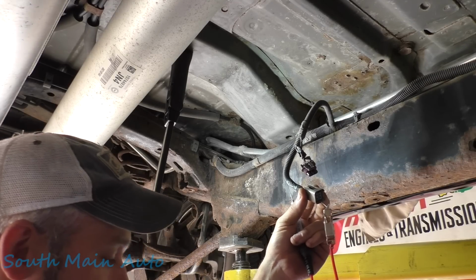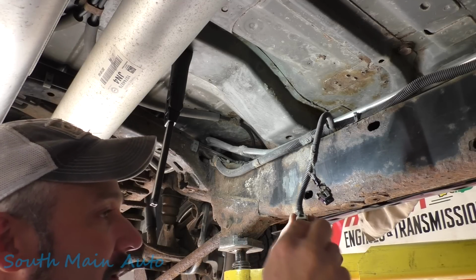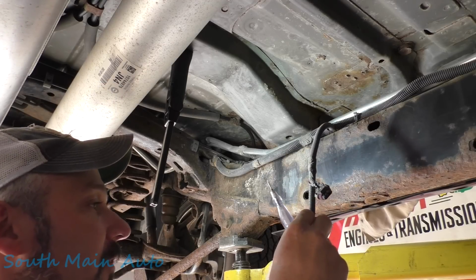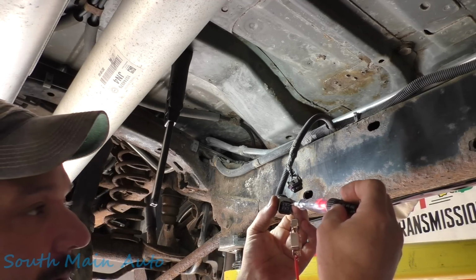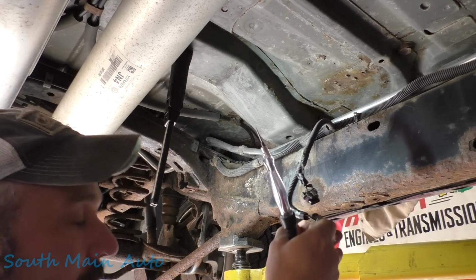We're gonna turn the fuel pump on. The fuel pump is on. I'm gonna make sure that it's on by touching the ground here for the fuel pump, and it is. And then the low reference, that's gonna be this orange with black. And we can see that it can carry 100 milliamps. So that's good. The only other wire that's left is the fuel level sensor wire.